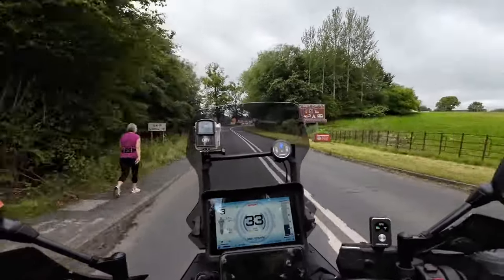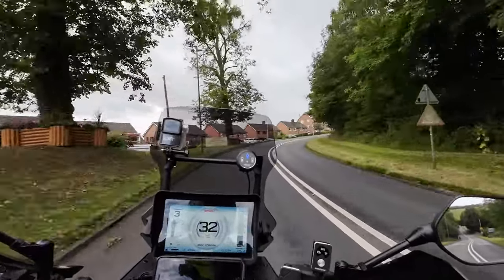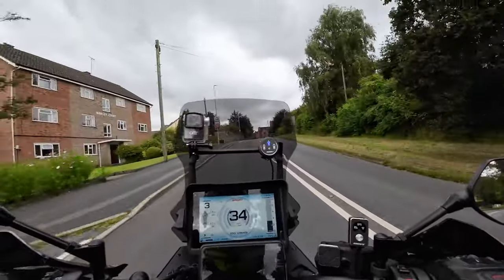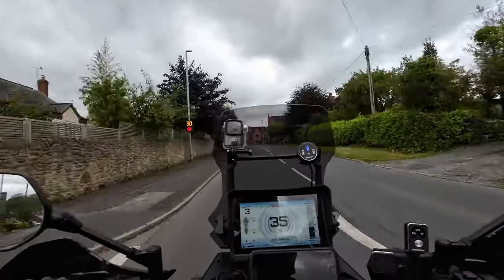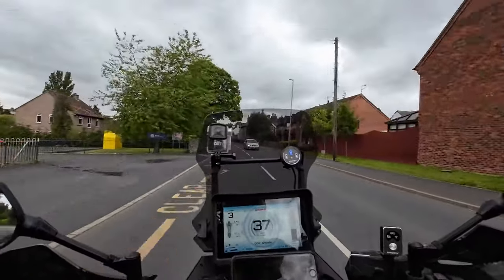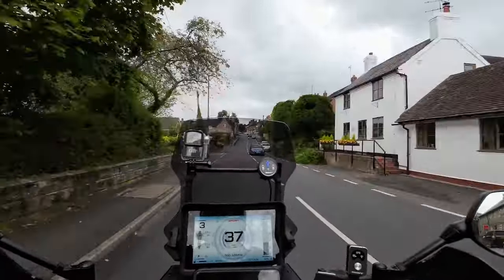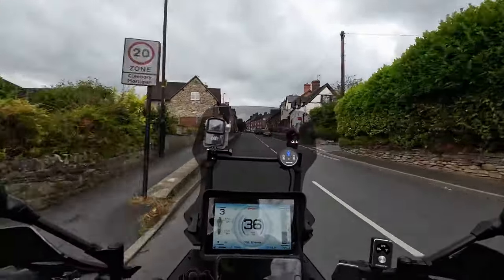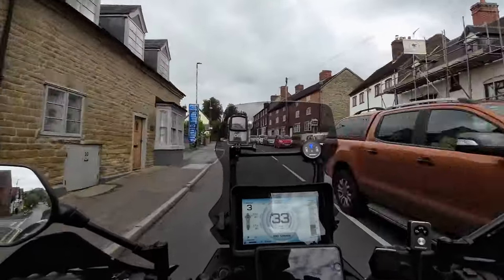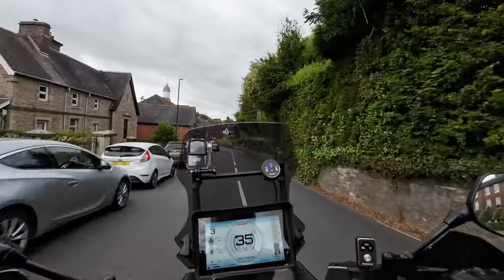So that leads us to the what, as in what difference does it make? Well, basically what it does, because it's higher gearing, you work in a different rev range on the bike. I have found between 3,300 and 4,000 is where the throttle is a bit snatchy, and you're in a different gear now. You're pulling higher, so your revs are slightly up, so you don't find it so much. It ain't rocket science, but it does actually work. And it suddenly turns the bike into something else.